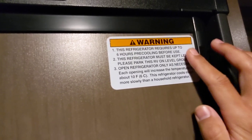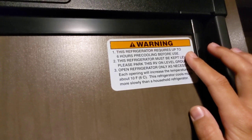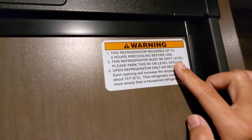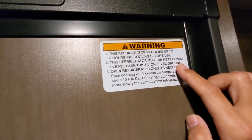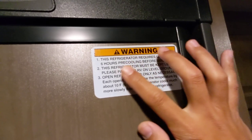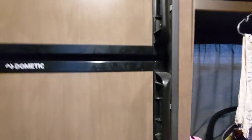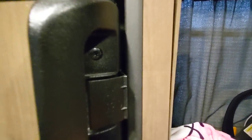There's a warning sign that says when you first turn it on, it takes six hours for the fridge and freezer to cool down, and when you open it, it loses its cool relatively quickly. The second bullet point says the fridge must be kept level — this is not necessarily true, but if you're not on level ground, make sure the door clicks in. If it's not entirely in, it's going to open on its own when the ground is not level or when you're driving the RV. So make sure you hear a click sound.